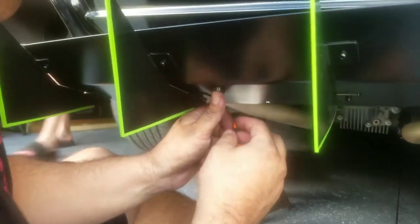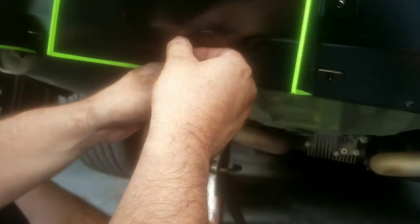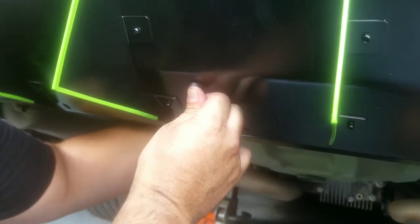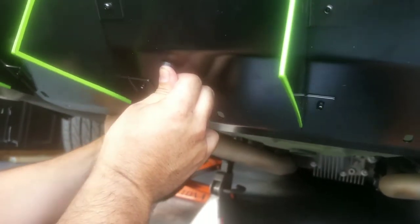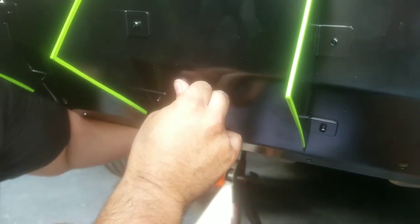Since I got the functional piece, we're going to be doing the 10 millimeter spacers. They're going to go in between the diffuser and your actual rear valence. So that hole you just drilled — bolt just slides in like so — then you just reach up past that piece of cardboard that you did not drill through. Pull the valence towards you, put the washer on, and then secure the bolt in. An open-ended wrench is the best way to go — 7/16 still. Run that wrench up there, put it right over top of the bolt. You've got the spacer in between the diffuser and the rear valence. Take the hex head and tighten those two bolts down first. So there's one done.